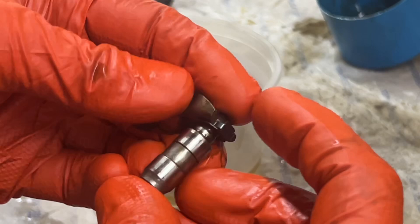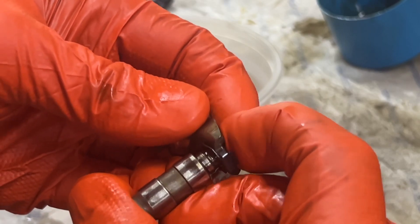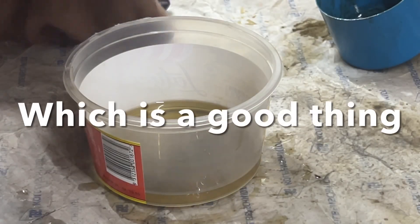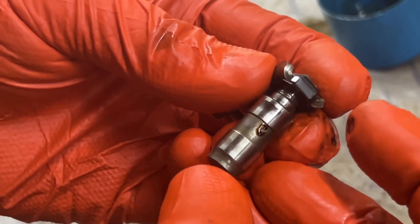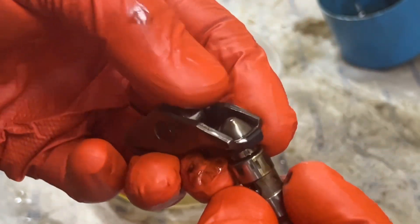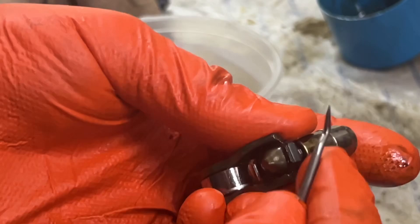This is one of those exhaust lifters and it is actually solid - we can see it has fluid in it. I don't know if it's seized or if it's just holding its fluid very well. What we need to do is release the fluid from this, check that it's able to be moved, clean it, and then return some oil to it to make sure it will hold its pressure. I'm confident these are holding pressure - we just want to make sure they're not seized.